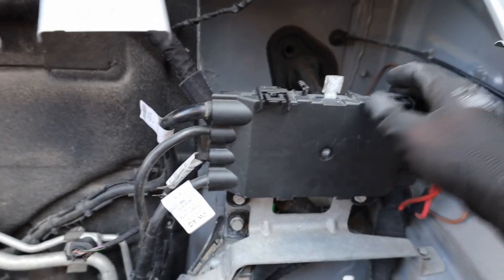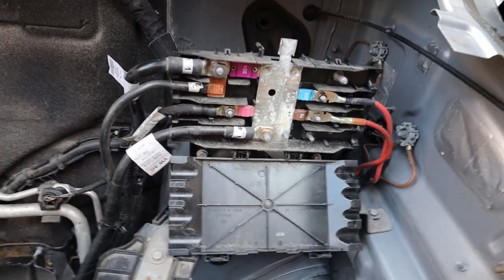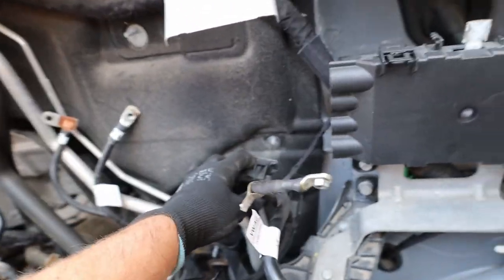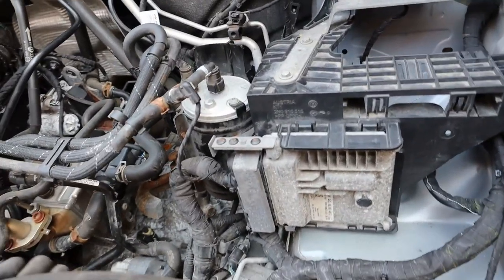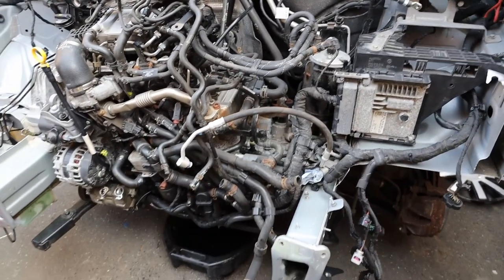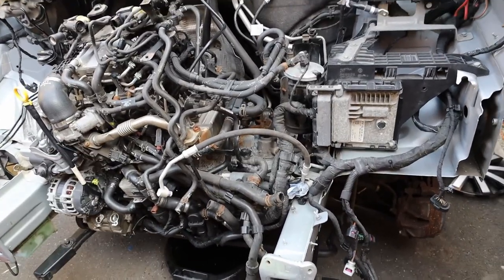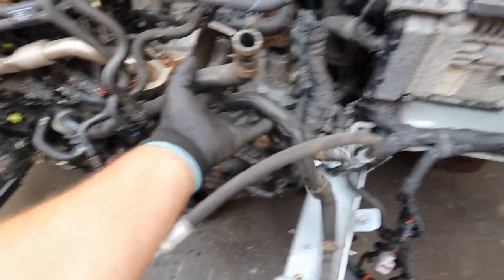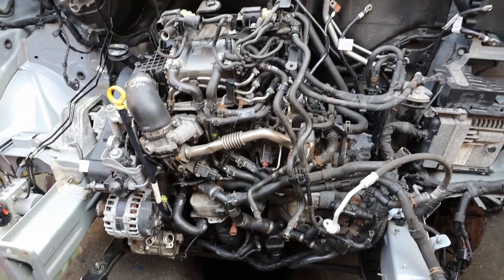So we just remove this cover. We need to take off these cables at this side - obviously just make sure the battery is removed at this point, you don't want any shocks off this. That's those off; they're clipped to the body but we'll start to remove some of those clips in a second. We'll leave everything else in place now like the ECU etc. The next bit to mention is I'm missing my coolant reservoir and any connected hosing - so if that was there on yours, you need to remove it at this point. Just make sure any of the pipes which were connected to it come off the coolant reservoir and stay attached to the engine.